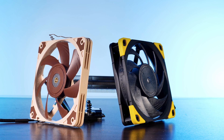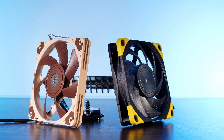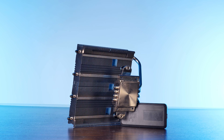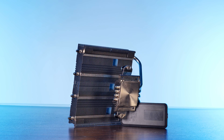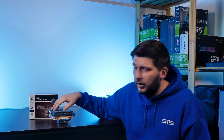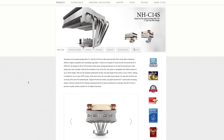Later on in this video, we will play around with different fan positions, installation positions, and orientations, and what happens if we give this baby heatsink a bigger fan. With a copper nickel-plated base and four heat pipes, Noctua formed this cooler in a C-type build format. At about 70mm in height, this thing is so small that it can absolutely count as a low-profile cooler — probably also the reason why they call it L12S, like low-profile 12S, not C-14S.